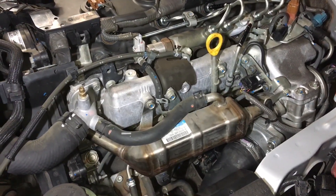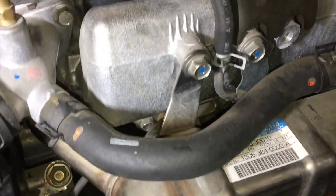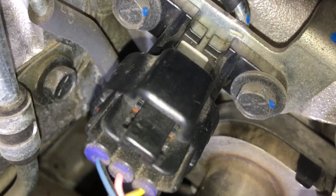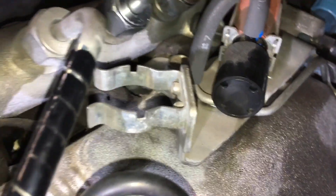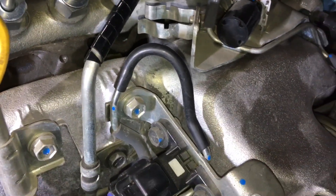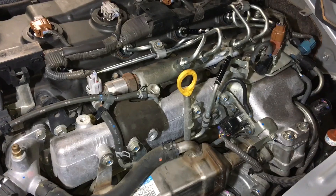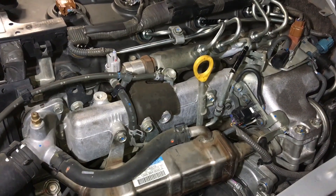Has anyone noticed anything while we're videoing around this engine? You can tell the genuine Toyota hoses — that's a genuine Toyota hose, that's a genuine Toyota vacuum hose to the map sensor. But see that black one? That's an aftermarket hose. And see that bracket? That's a bracket for a map filter — an expensive little plastic thing made by Aisin, about $60 worth. We normally replace it, but it's not there. We're going to recommend to the client that we order the parts — I would highly recommend the map filter stays in place, as the engineers put it there to protect the map sensor from contamination.